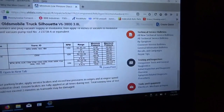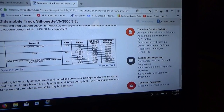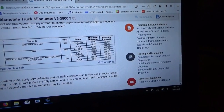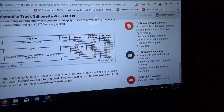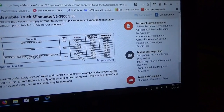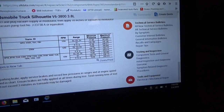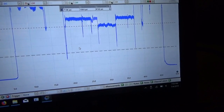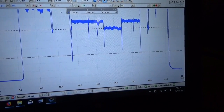It's over 200 for sure — it's a maximum pressure check and I wasn't even revving it up at all. 200 PSI in D1, it should drop down to about 160 to 170, and then back up to almost 300 in P, R, and N — that's what we're seeing. D2, D3, D4 should still be visible on the scope. That's when I shifted to reverse — went off the charts.